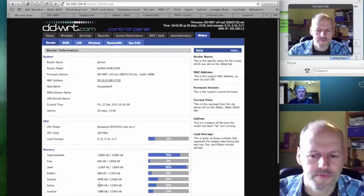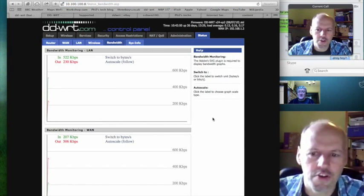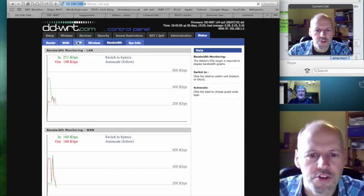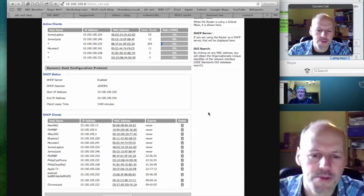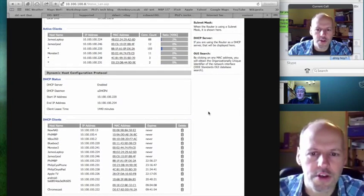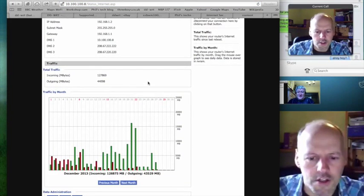It's amazing, and so you can see a lot of what's going on. They really are very modest little computers, little 200 megahertz Broadcom computer. Well, I love the way that you can go to this status screen and it gives you a summary of all your MAC addresses that the DD-WRT router is using, for example, and stuff like that. Those sort of things are really hard to get hold of from shop-bought routers provided by ISPs. That sort of information you have to spend a while fishing around for. Whereas, just because this is all open software, all that information is freely available for yourself, which is helpful in terms of administrating it.